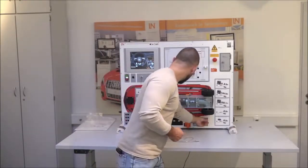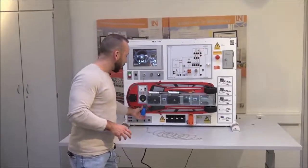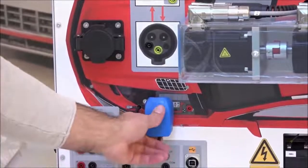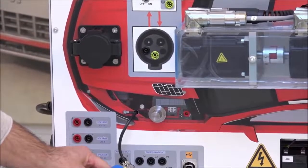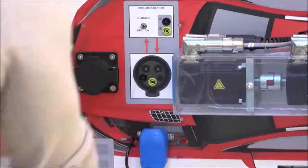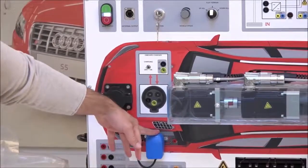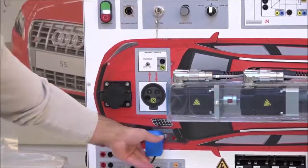Also important: the 12-volt battery connection. There's a fast-disconnect switch at the minus terminal of the 12-volt battery that can be released quickly. Press it down to connect it and make sure it's tight — without the 12-volt battery connected, you won't be able to activate the car or put it into ready mode.